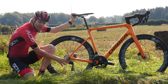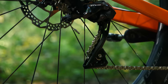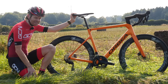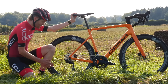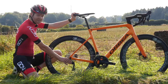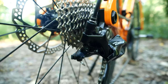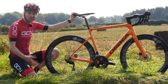So the 105 rear mech we have here, we talk about trickle-down tech, but this hasn't so much trickled down from Dura-Ace, it's more trickled down from Shimano's mountain bike group sets, XT and XTR. So it's got what Shimano calls a shadow design. Now, the advantages of this are that it's designed to sit closer in to the frame by 12 millimeters, which makes it less susceptible to damage should you fall off your bike. And we know bikes are like toast. They always land butt side down. Weird.